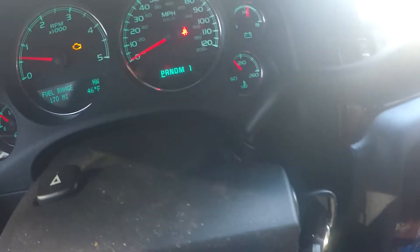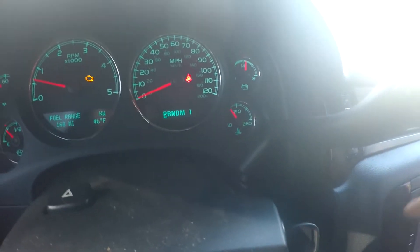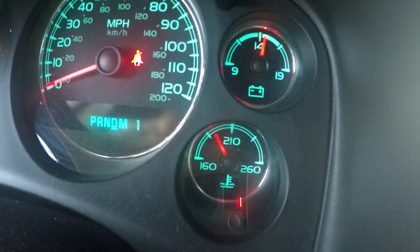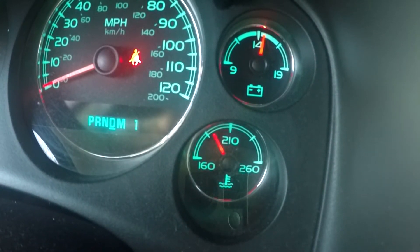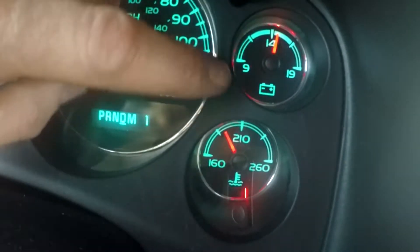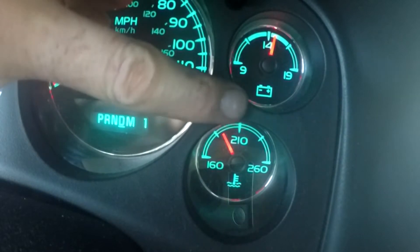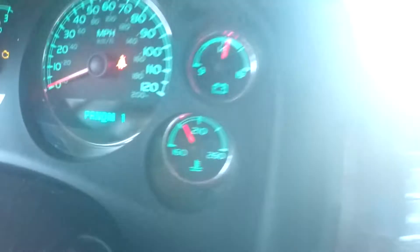So if you have an LML and you're driving, and I just literally got back from an hour-long ride — if your thermostat sits there the entire ride at that like one-fourth mark between 160 and 210, you have a bad thermostat. These LMLs, it should ride with a good thermostat — after you drive a little ways and it's up to temperature, it should sit at the 210 mark. Even though it's not technically 210 degrees, this is typical GM fashion — that gauge is so inaccurate. It's just a guess, and I'll prove it to you right here.